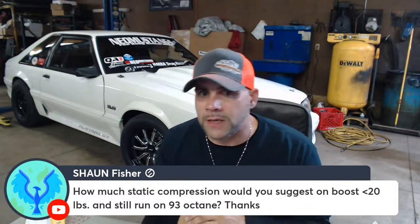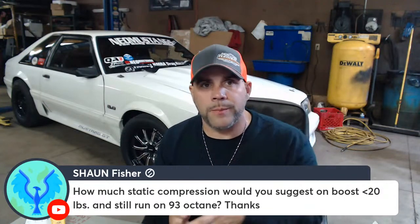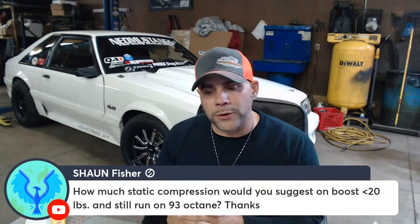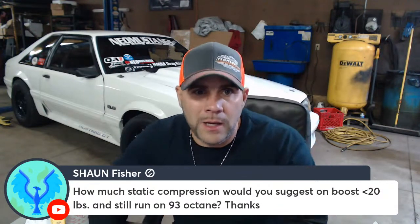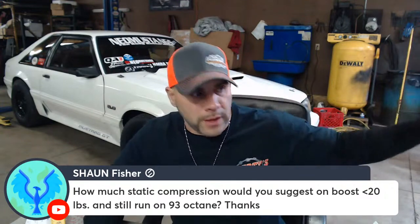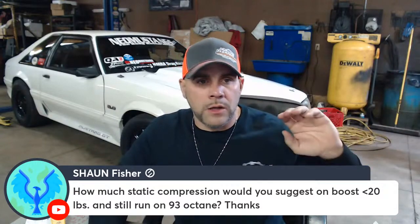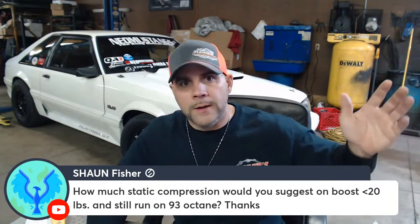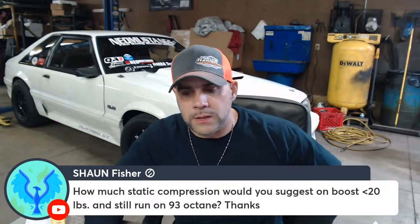So E85 likes timing. It burns cold. It's oxygenated. You get it for $3 a gallon, and right now 93 pump gas is like $5 a gallon. So consider running E85 for a year or two, and you probably pay for your own fuel system. But static compression, at least with E85, you don't have to worry about questions like that. But as far as 93 is concerned, if you start putting money into your motor, and I've preached this for the last 10 years on my channel, go do yourself a favor, go out there and buy you some 110, some $10 a gallon 110 at a fuel store. I mean, if you don't drive your car all that much, then mixing fuel isn't necessarily a bad thing to do.